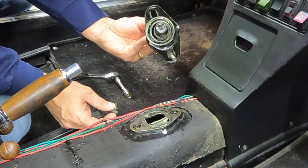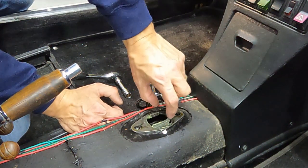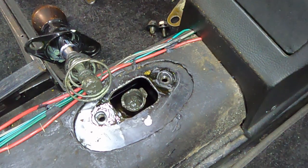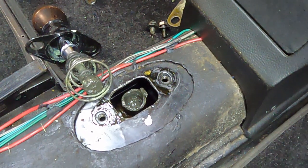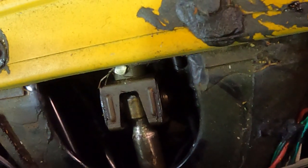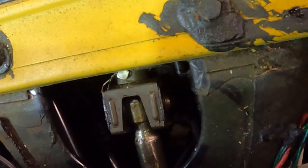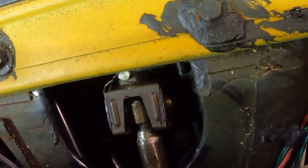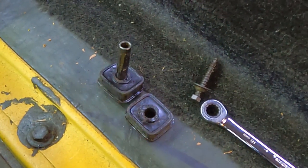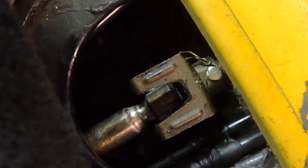You can see the shifter is kind of spring-loaded into this pocket, so we'll set that aside. This guide can also come out of here — that goes along with the shifter. As you can see, the shifter is pretty much just a ball and socket. That socket down there is the rod that we will now have to remove to replace the shifter bushing. Now towards the back of the car, you have to separate the shift rod from the shifter assembly on the transmission, and that is done at this little coupling — you just remove that bolt and that thing separates. The shift shaft is held in by a bolt and then that push-through rod that supports it, with the rubber bushing on each end. It is now separated and the shift rod can come out the front of the car.